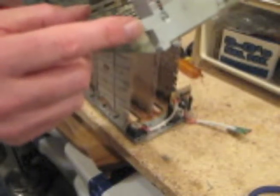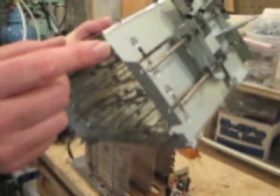Remember the small metal tabs. These will need to fit into their appropriate slots and then be twisted a quarter turn for this to stay in place. When you're putting the chassis back on the toaster, don't forget this metal trip bar.